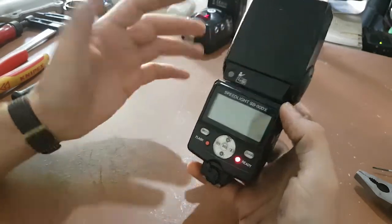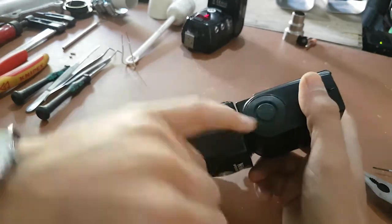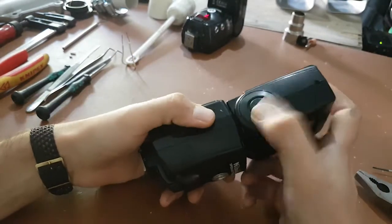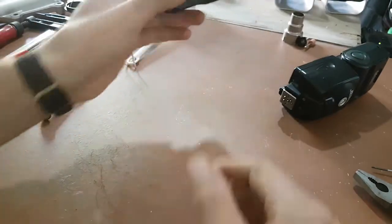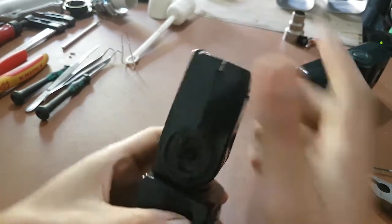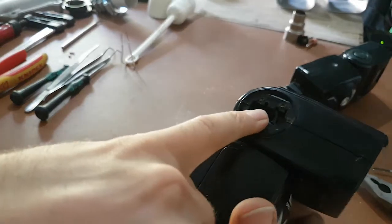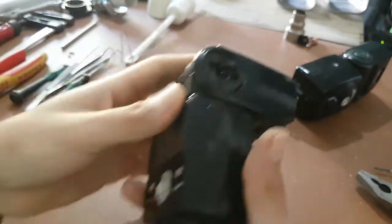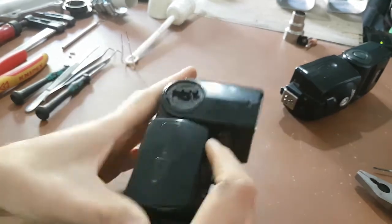There are two ways to discharge these flashes: one easy way and one safe way. The safe way requires you to remove this rubber cap — the reason I will not use it is I don't want to remove it, because later you need to glue it back. What you do is remove this cap, and I have a flash where I already lost that cap. After removing it, you tilt the head 90 degrees down like this, and you see these two holes — those holes will lead you to the terminals of the capacitor. Let me charge the capacitor a bit... that's enough.